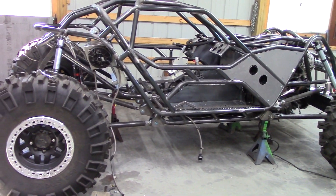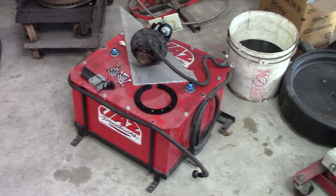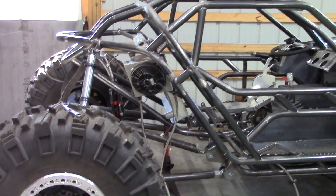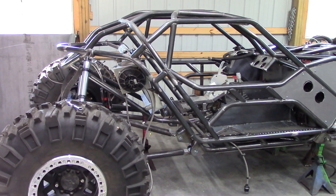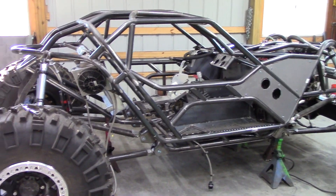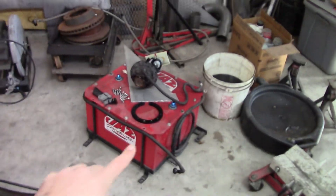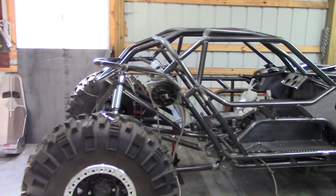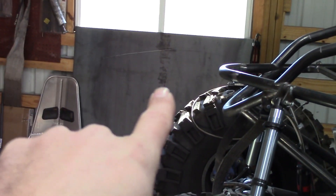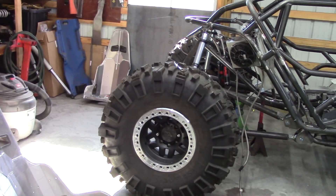Those reusable dash-20 fittings are pretty expensive. That brings us to the fuel cell — I started disassembling this one. I could have easily built the back of the chassis to fit it and saved a lot of time, but I personally think custom fuel cells built to the chassis lines look the best. That's what I did on my last buggy, so I built the back of the chassis exactly the size I wanted. That fuel cell did not fit at all, so I've got to turn flat sheets of steel into a nice-looking custom fuel cell built just for this chassis.